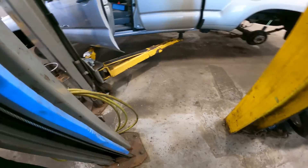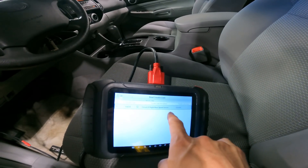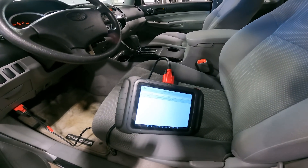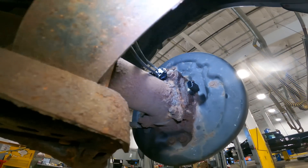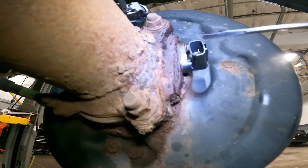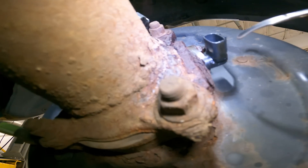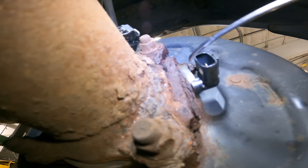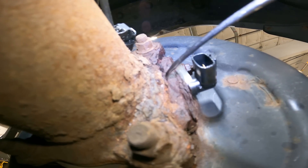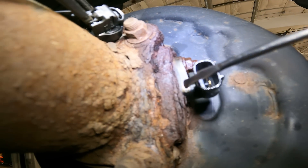We confirmed the light is on during a road test. We scanned the vehicle and found a right rear wheel speed sensor circuit fault. Let's take it up top and see what's going on with that sensor. Now that we're at the right rear wheel, we can see the pins inside are okay and the harness side is okay. But see all this rust? All those layers of rust are between the housing and the sensor, and it's actually pushing the sensor out.